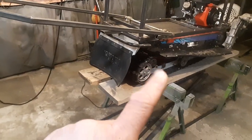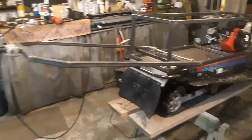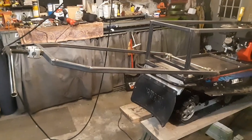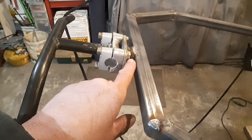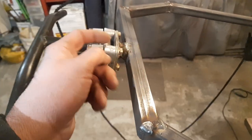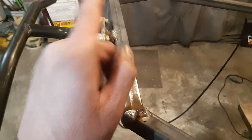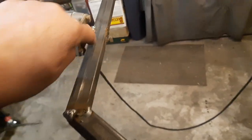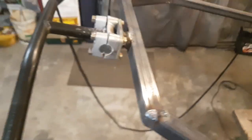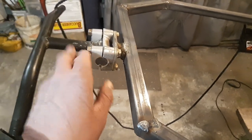I think I'm going to have to lower the suspension yet, so there's still a lot of work left. What would be nice is these handlebars — I drilled a one-inch hole through here. That used to be a steering shaft that went down to the skis, so I cut it off, drilled a hole through this, shoved this through and welded it here and here. So that's not going to go anywhere, and now I've got the adjustability to move the handlebars up and down.